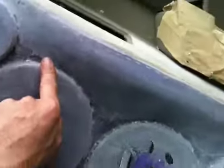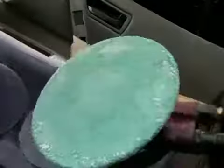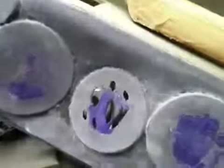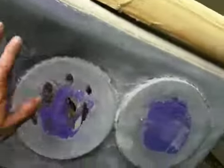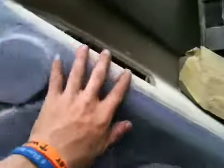After I grind it, I go over it with 40 grit, right? My DA. Get your DA, 40 grit. All right, if you ever see this green paper, it's the best stuff. Lasts a real long time. It's only 75 cents a sheet. 40 grit, hold it flat. Now, it gives you this, all right?